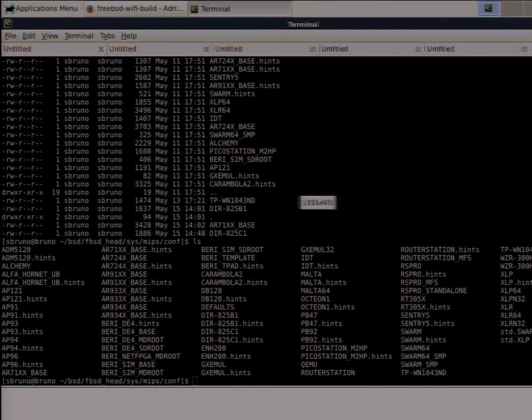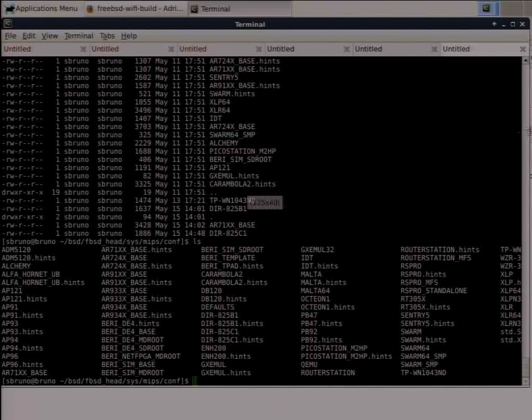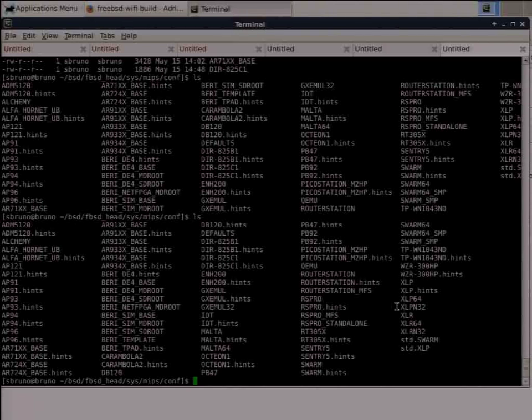This one is a really, really easy to use, not very secure in the slightest Buffalo model. So this one is really great to play with, but don't put it anywhere where you care about your data. This one will TFTP anonymously on every boot. So if somebody is on your network and provides a TFTP server with a flash image, it will auto burn that image to its flash for you. But it's branded as OpenWRT friendly, and there's no way to turn that off unless you do something. So this one was the first one. Absolutely, right? Because nobody's going to have a rogue TFTP server on your network.